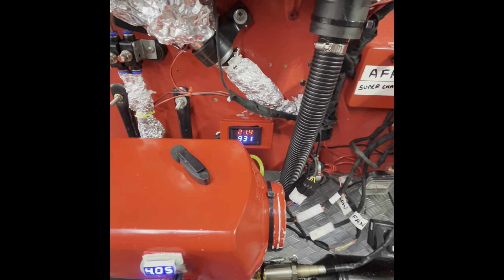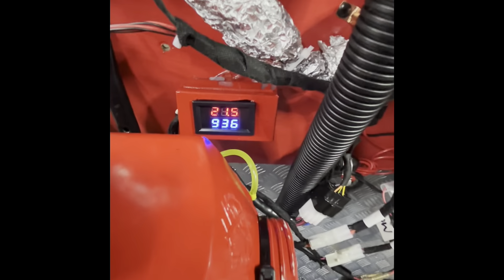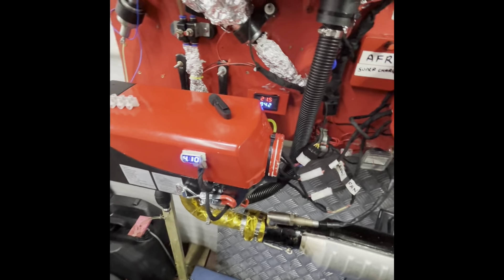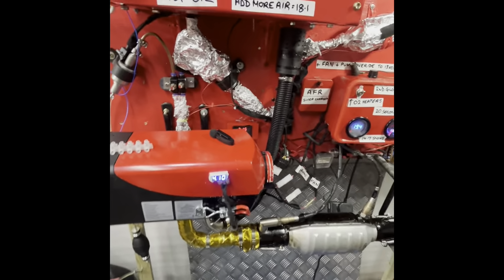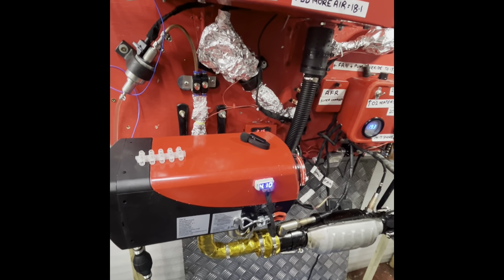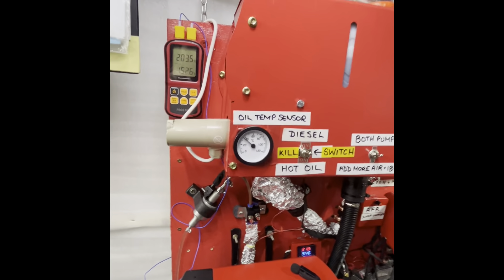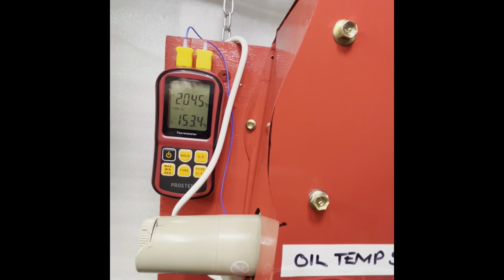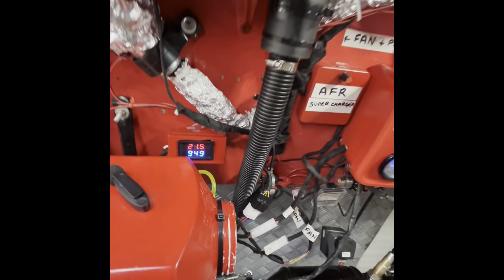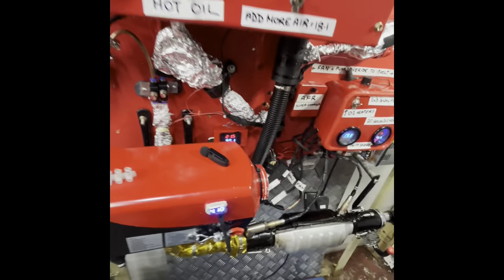When I started it out I was expecting it to show me 300 degrees something like that, but when I look at my nickel strips - when I put the part they were like a really nice green colour, and the top of the burn chamber looked like it was sandblasted. Okay, we're up to 205 on the head, we're still climbing in the chamber at 949.